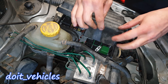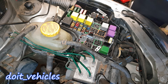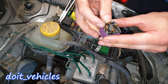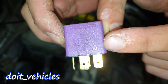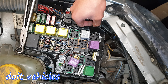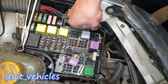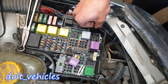If for some reason the fuel pump is not activated when you turn the key in the ignition, go ahead and open the fuse box and you're gonna find this pink relay. Look for pin 87 and 30 — those are the switch terminals for the fuel pump. Connect these two pins and the fuel pump turns on. That should activate the fuel pump regardless of whether the key is in the ignition or not.